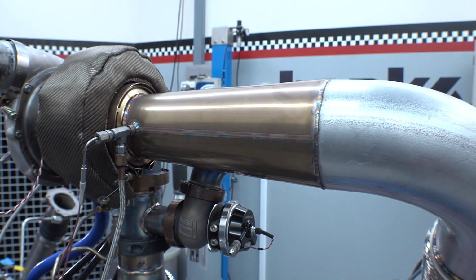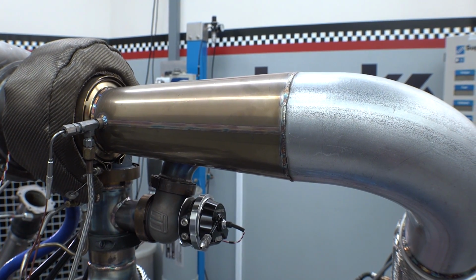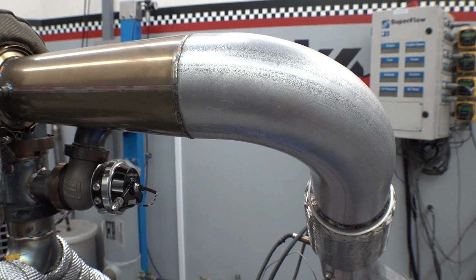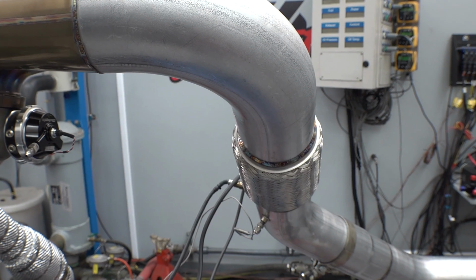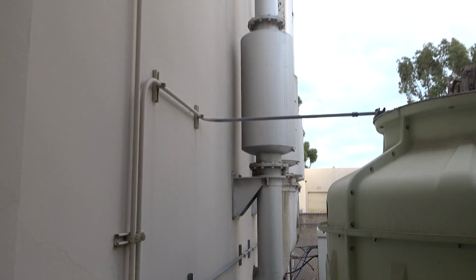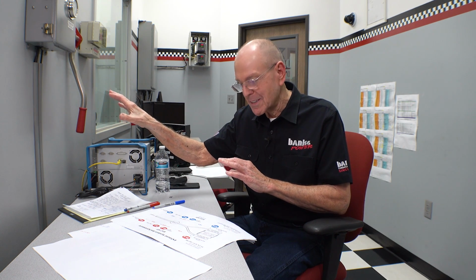Remember that 662. Now, we made some mods. Our tailpipe went to 5-inch, but we put a conical diffuser coming off the turbine, starting with turbine diameter, then into the 5-inch, through the wall into 10-inch, up the wall outside. In both cases, on both of these runs, that 10-inch acts like a chimney in a fireplace. In other words, it's helping to scavenge the system. It's the same impact. We didn't change anything out there.